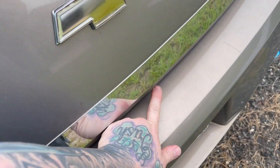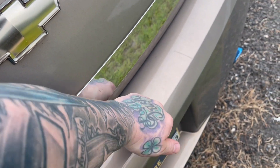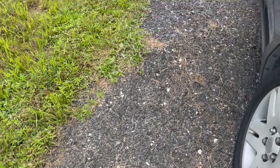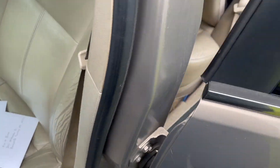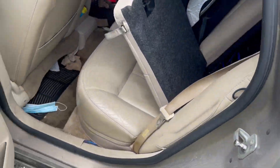On the inside of the trunk is where that solenoid is, so sometimes if you bang right here you can get it to start working again. Mine's working at the moment, but anyone with subwoofers — over time the bass is going to make that solenoid go bad.